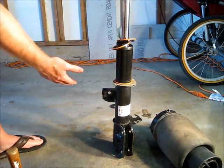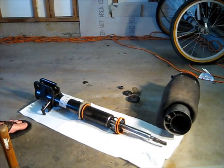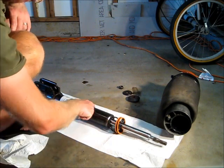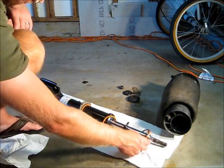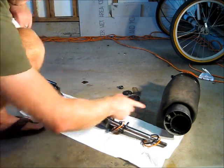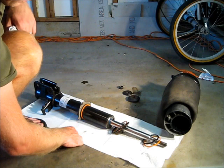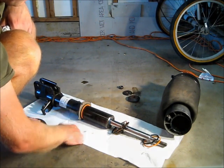Now we'll clean all this up extensively and go ahead and replace it with our brand new air spring. With the two components separate, you can begin to see how this all works. You have a normal strut and this air spring fits over it and seals. The air spring has these big O-rings — a set that seals on the bottom and a set on the top. These are likely the seals that broke causing the leak. It's critical that we clean this as well as we can, otherwise the new bag may develop leaks, so we need to prepare it for brand new sealing surfaces.